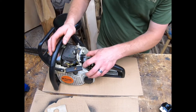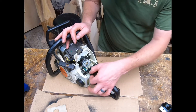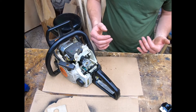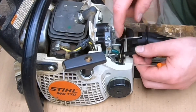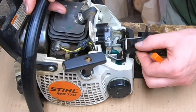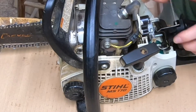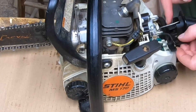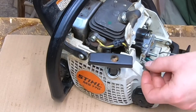The carb is not going to come right off yet — there are still pieces in the way. We need to unhook the throttle and choke levers, which can be a little tricky. First step: come in where the choke lever is and pop it out of place. Put your screwdriver in and just pry up gently. This whole black rod will pop out, then you fiddle around because there's a little connecting rod — pop that out and get the whole black rod out of there.